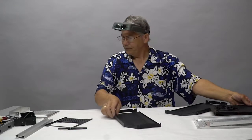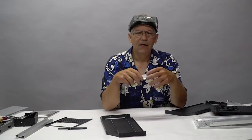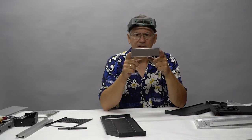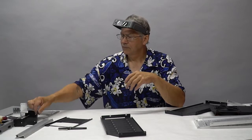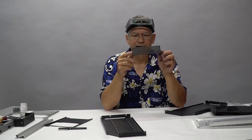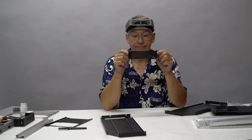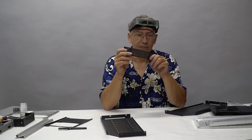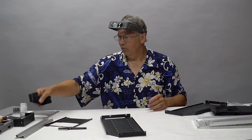So then, bringing air into the case, it's got to be filtered. This is the original cover plate that went on your TJ07. There's like 7 of these things. We're going to take 3 of them and we're going to replace them with these aluminum cover plates. Black anodized aluminum, they're drilled, and they have filter mesh behind them, so that the air coming into this case is going to be clean and filtered. We don't want to be bringing garbage into the case. Dust bunnies aren't good. So that will help that out. We'll go over that more once we get the case assembled. You'll be able to wrap your head around exactly how that works.